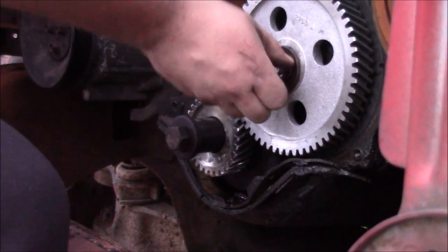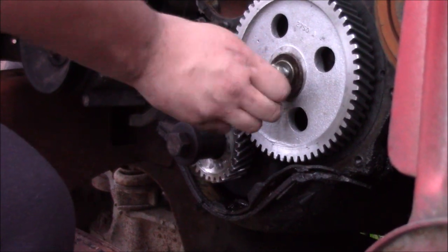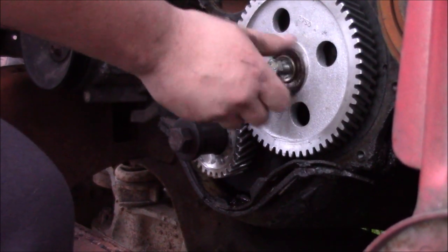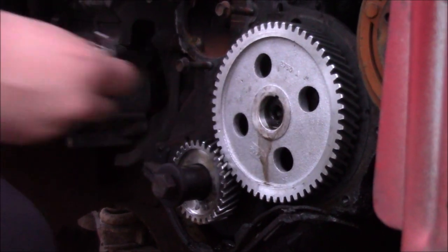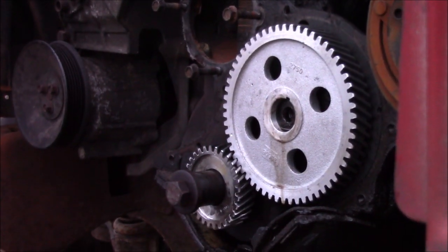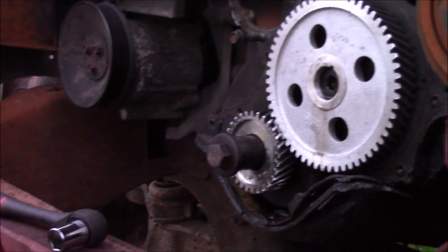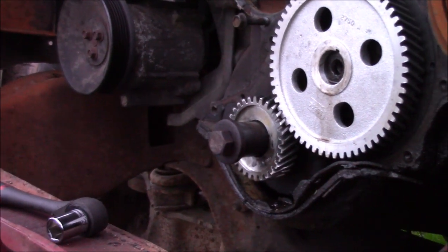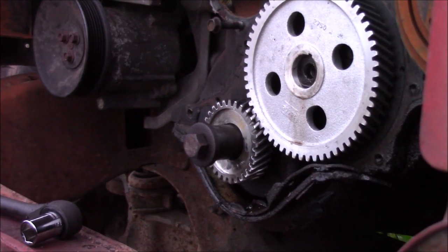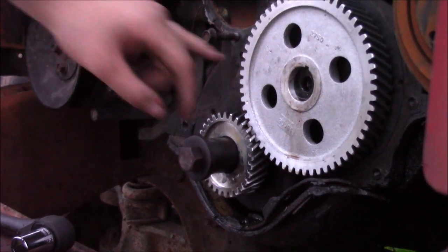If you're going to buy this stuff, I definitely recommend trying to buy some sturdier washers, maybe. Because these washers are what actually is causing my problem. They were actually bottoming it out because they were beveled in so bad. So I'm going to change up that washer setup. But regardless, that's pressed on pretty far.